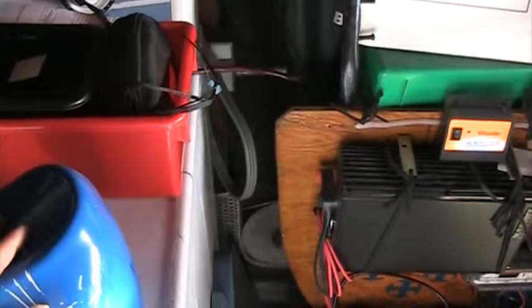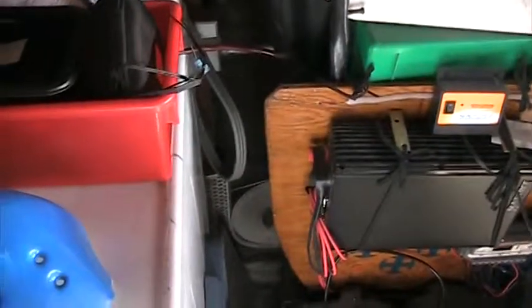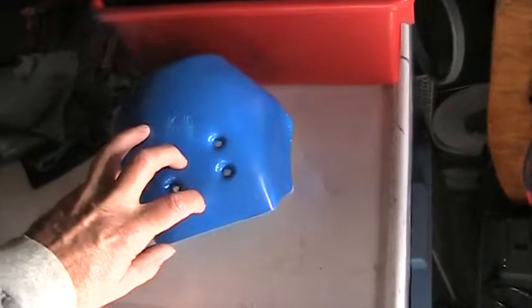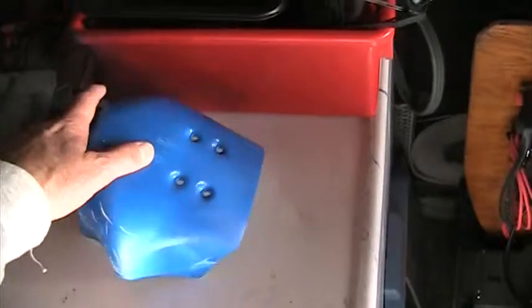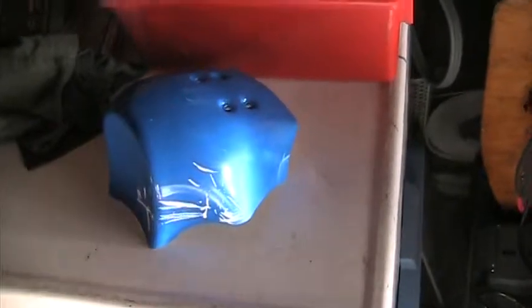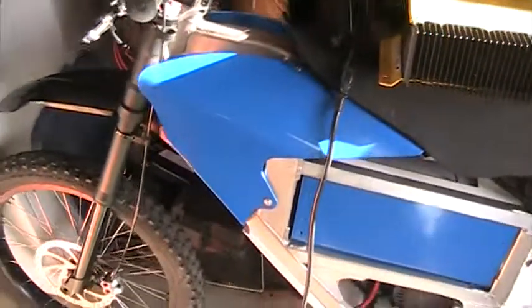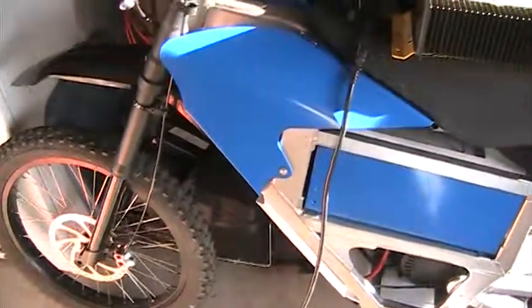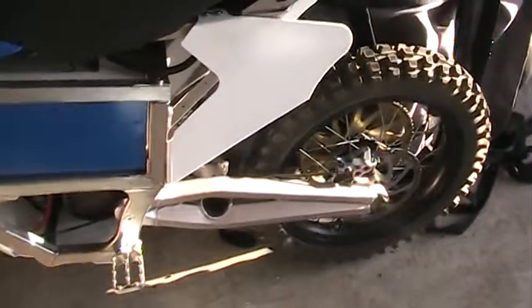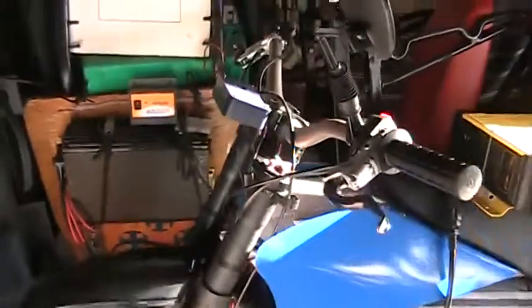This is an example piece — this paint is almost two weeks old. The Krylon can be scratched off with your fingernail when the surface was only cleaned with alcohol. On the other hand, a sanded panel is much harder. The Krylon paint is fairly cheap and fairly available, but you definitely want to prep the surface otherwise you're going to have adhesion issues. You can get some color on these things, it improves the look a lot — pull the plastics off, sand them, prep them, and paint them in a matter of a few minutes.